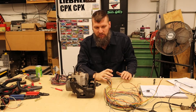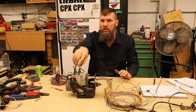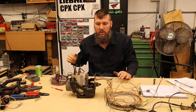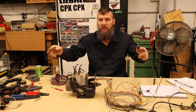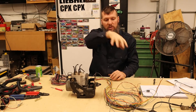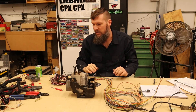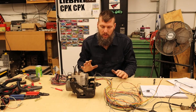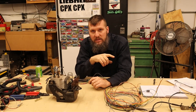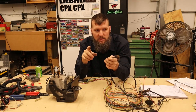I think it'll make it a little bit easier for some of the wiring and brake lines — the rear ones I'll probably run brand new ones underneath the carpet and then out to the rear axle. The front ones I can pop back through the firewall nice and easy. For the ones from the master cylinder, I don't need to run from the master cylinder all the way to the front corner — I can just run along the back of the firewall inside the car, nice and short. Another thing: since the car doesn't have ABS, it means it doesn't have any of the ABS sensors or rings on the car.